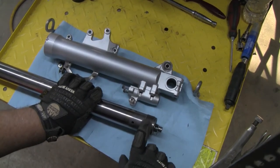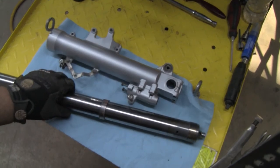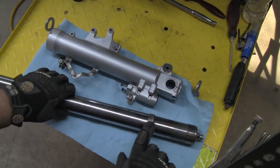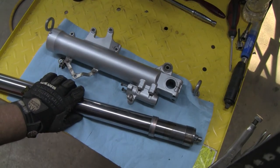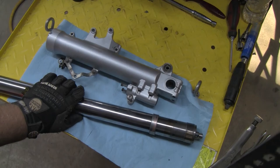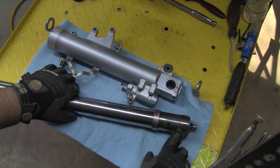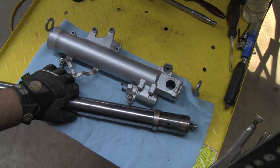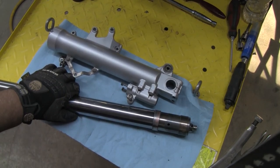I am going to replace these bushings, which are very simple to replace when you're doing fork seals, just because the inside of this bushing still has all its charcoal gray bushing material distributed all the way around the inside — so I don't think it's wore right down to the backing plate. Whereas this one is wore down to the backing plate. So anyway, that's the update — a little bit of preventative maintenance and away we go.